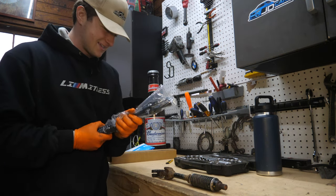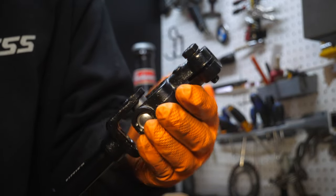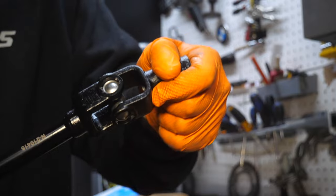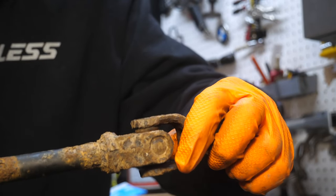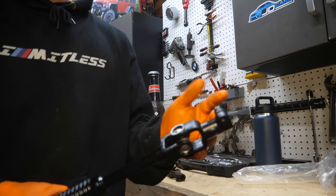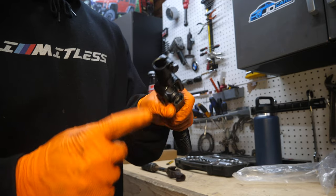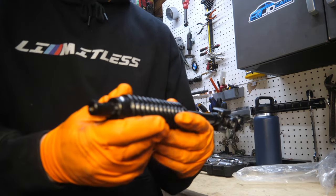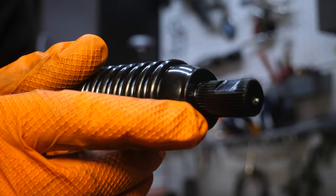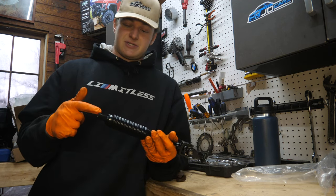The new shaft even came with a new bolt and lock washer — we don't have to go to the hardware store after all. The new U-joint feels phenomenal — obviously no play compared to the old one, which was obscene. I'm applying a little anti-seize to the shaft before installation to make things work better. One important note: the upper part of the shaft that goes into that coupler has a keyed flat spot — that needs to be up top where the bolt goes through, otherwise it won't go through. Keep that in mind when reinstalling and installing the top bolt.